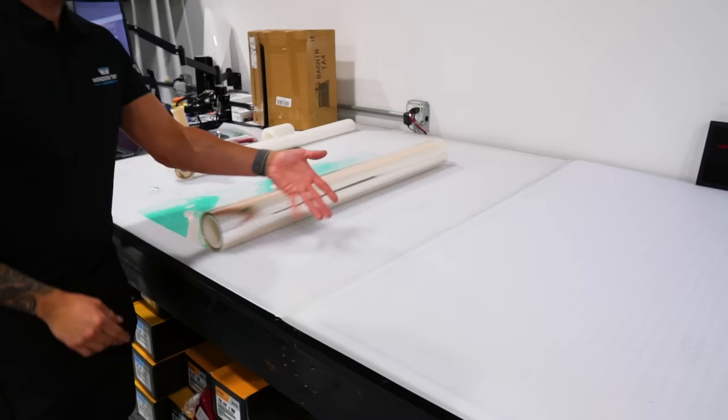To do that, I'll use a different blade on the glass. That way I don't cut the glass at all, because I have these 30 degree blades and they are extremely sharp and it will cut the glass. That's why I cut in the tape with those. But if I do have to cut on the glass, I use the regular Olfa stainless steel blades. Very light pressure.